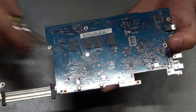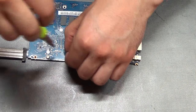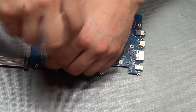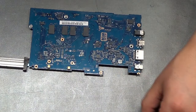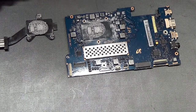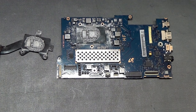Removing the heat sink — really easy, just flip the motherboard over. Three screws holding it in place, no specific location for each of the screws, they're all the same size. My thermal paste — while I'm getting the things to clean the thermal paste off, keep in mind that thermal paste does expire.